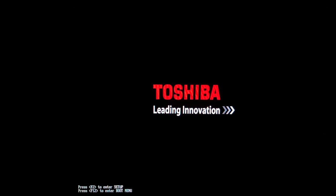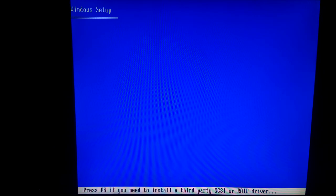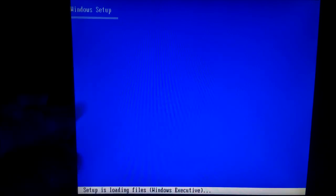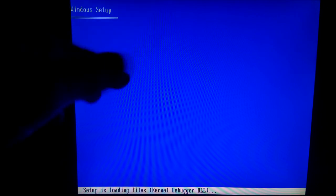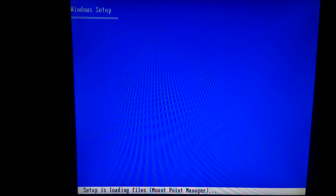Just wait for it to load, then press any key until the prompt disappears — and there we are. As you can see, it is loading the Windows XP setup. Don't press any keys here; the ISO I gave you already has integrated drivers, so just wait for it to load and then you can do the setup. Thank you for watching — I hope you understood everything, and see you in another one.